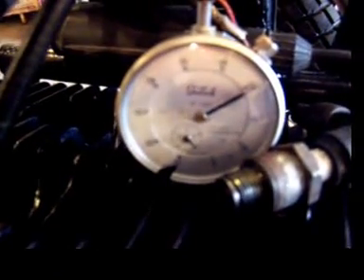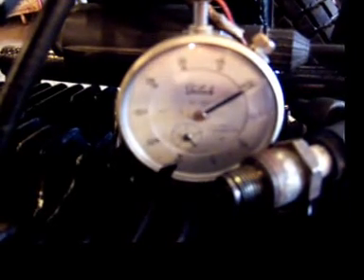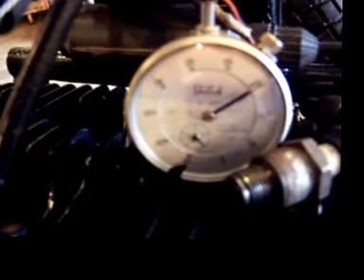We've got to make sure we don't go too far. Turn the ignition on — spark plug is right there. We're aiming for about 65 to 70 thousandths before top dead center. 70 thousandths is 1.8 millimeters, which is the recommended safe setting for these motors, so we'll go between 65 and 70.